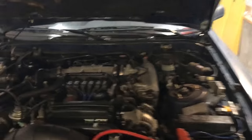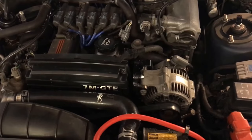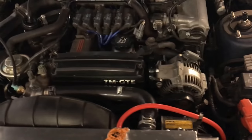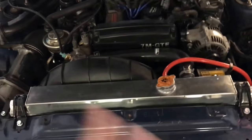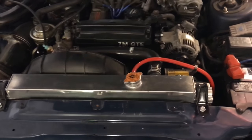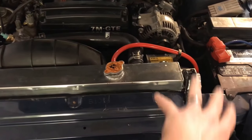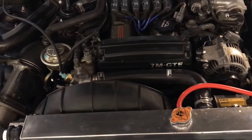Nice and smokey — just like before, I wouldn't expect any less. But obviously I got the timing right — timing belt teeth are all aligned correctly because that's just turning like a kitten right off the bat. I'm just going to let it run and let it warm up a little bit. Cooling system note: you do not need to burp a 7M. If you have to burp your 7M's cooling system, you have a problem with your 7M's cooling system. You should just be able to fill it up, start it, run it — it will pull fluid from the overflow container to fill up the radiator. If it doesn't do that properly, there's an air or coolant leak somewhere.